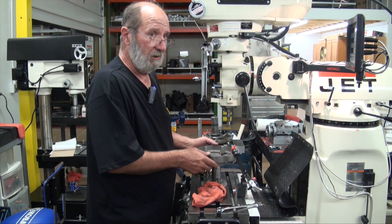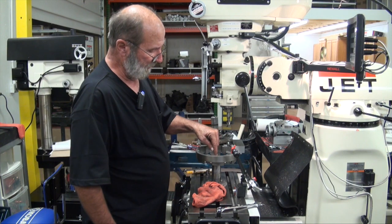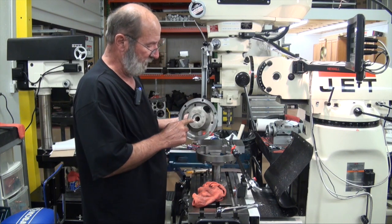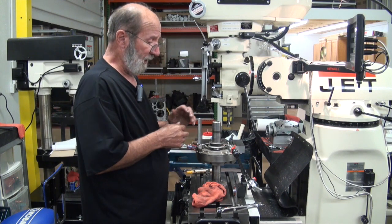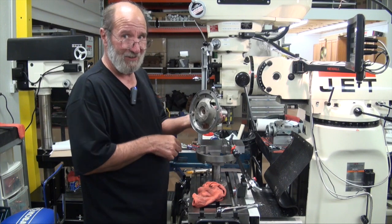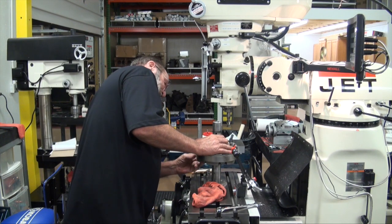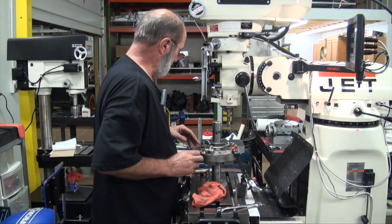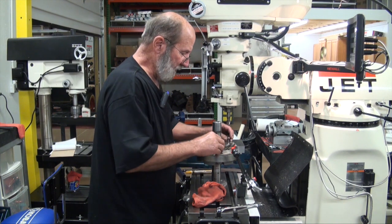Then I'm going to snug down three bolts and try to keep it where I got it centered. And at that point in time, because we centered the bushings on the lathe in the brake drum and we centered the bushing in the drive plate, in theory you should just be able to plop that down over a main shaft and tighten things down. But it really doesn't work that way because there's really six ways that you can put this on. So I go ahead and set it in place, find a location, put in three bolts finger tight, and drop it down.